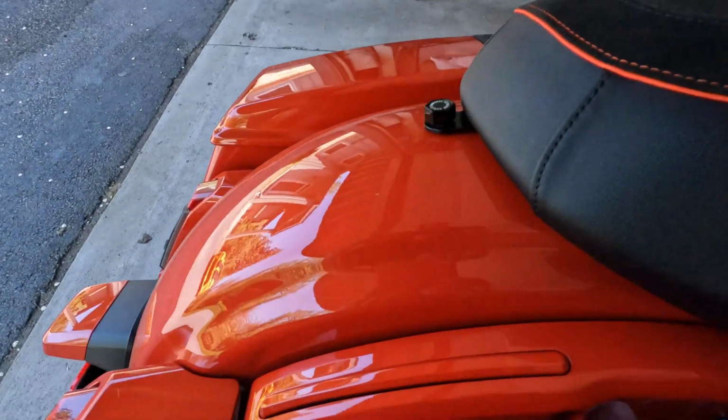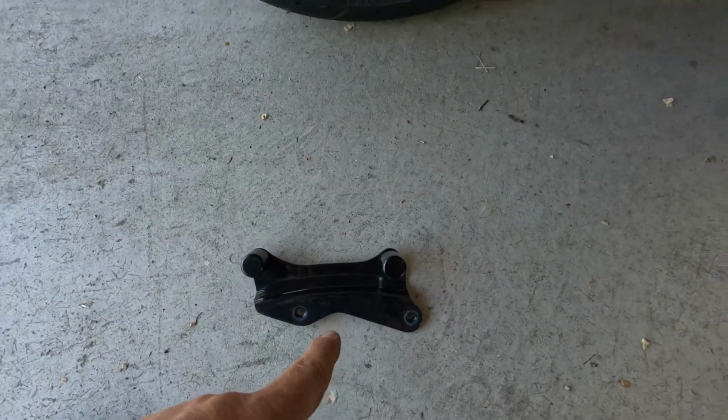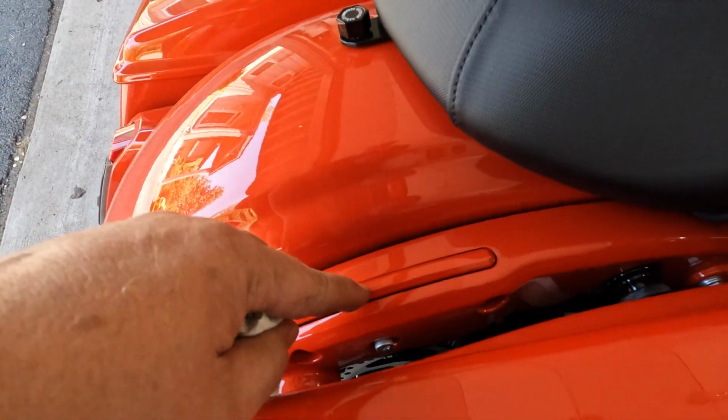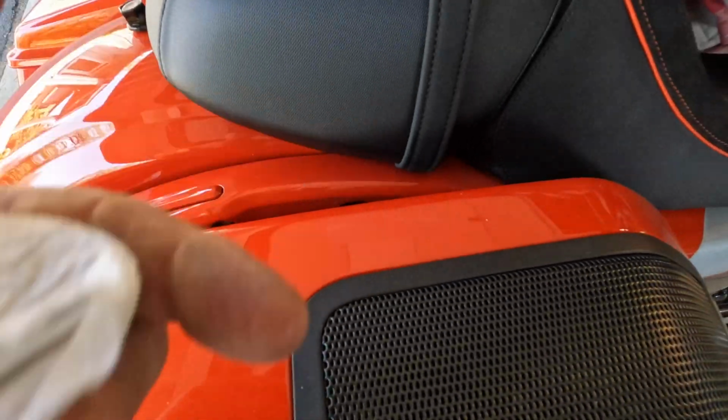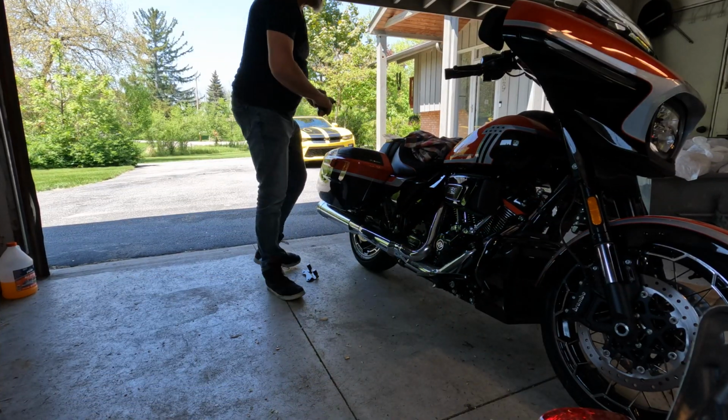Now I'm going to put on the detach hardware. So you just have to take this little guy out. There's a screw here and a screw here, a couple of Torx heads. Drop this guy in, so this sucker pops out. Drop the new ones in. You just have to let the saddlebag down. It's a four-handed job, so I'm going to put the camera over.